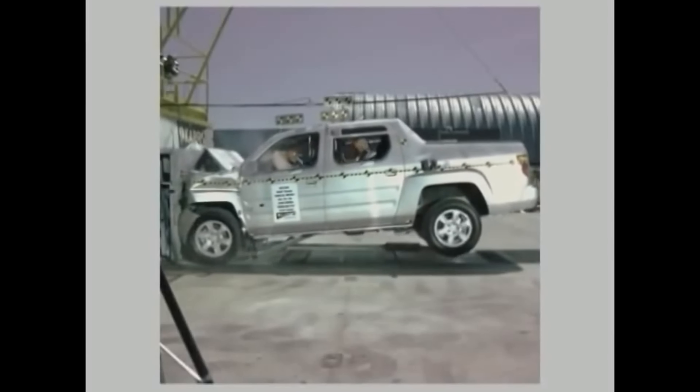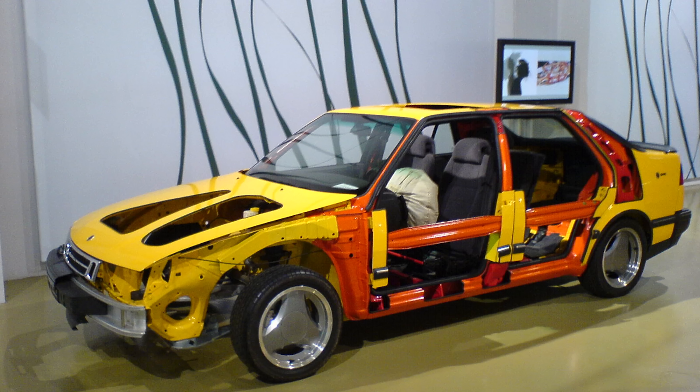A maximum threshold force is useful in vehicles. Modern vehicles have become much safer because they have specific crash zones meant to crumple. When something crumples it absorbs energy, so the occupants don't absorb it themselves. There's a safety cell where occupants are inside, and then crumple zones around it. These zones are supposed to crumple in a wreck — modern vehicles specifically use hollow structures so they can fold and absorb energy without exceeding some threshold force.